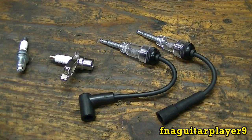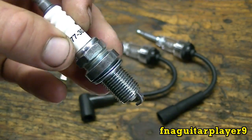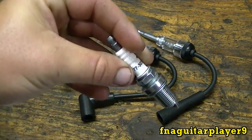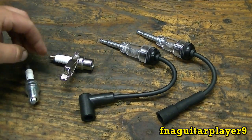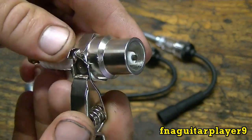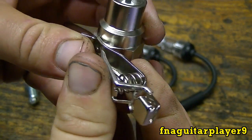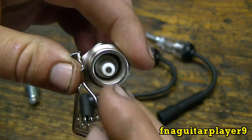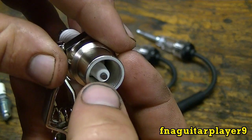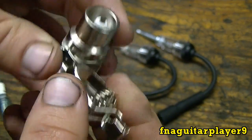I've got a regular spark plug here. The method I've used most is just hooking the spark plug wire in and grounding it out to actually check for spark — that's always been reliable. The second method is similar, but I bought this tester for about five dollars. It's got a clip to ground it to the block and you hook your plug wire to it. It checks for a bigger spark gap, so if a spark jumps that far you know you've got a pretty hot spark, good enough to fire the plug.